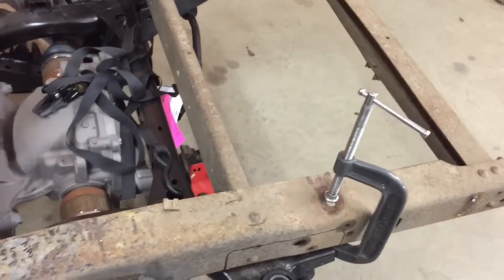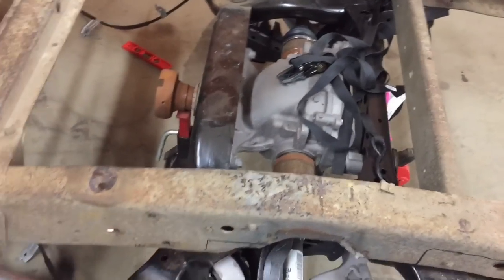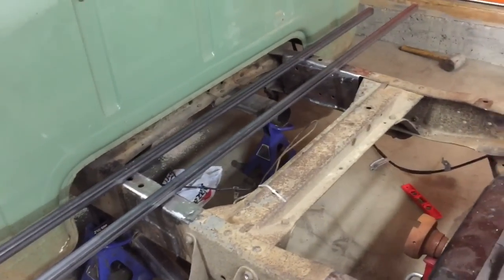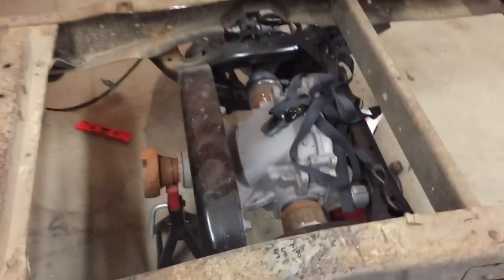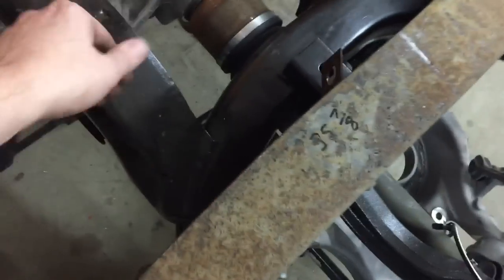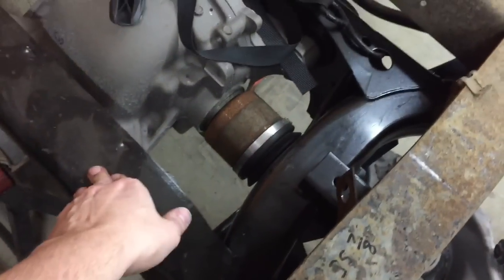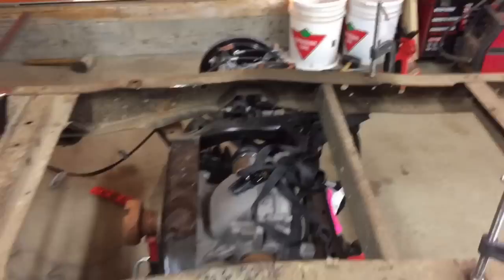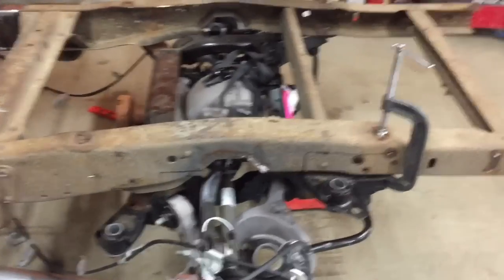I think I'm just going to cut these ears off the outside of the subframe and I'm going to weld it solid to the old frame. I've got some square tubing I'm going to run across the front of the subframe and it's actually going to sit right in here and it'll carry the load right across the whole subframe, both there and there. That should make it pretty stiff too. No more worries about flex.